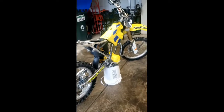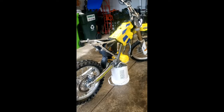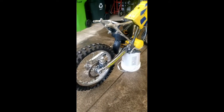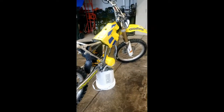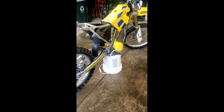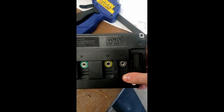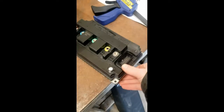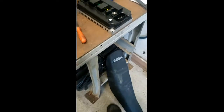I'm here in the garage and I got this 2007 Suzuki RM125 that I'm going to convert to electric. I'll just give you a quick rundown of what I've got as far as components. First things first, I got the motor controller over here. It's a Votol EM150-2 controller — it's a newer version than maybe some other Votol EM150s you've seen.